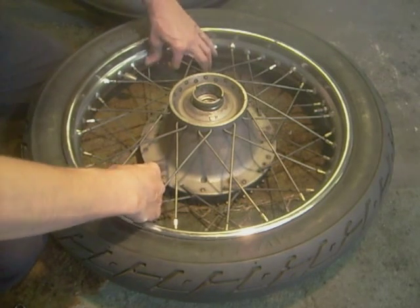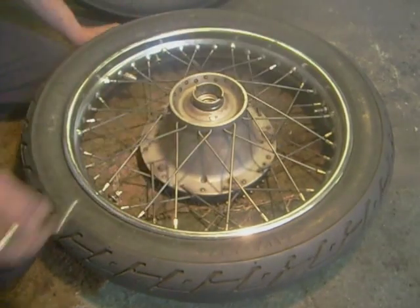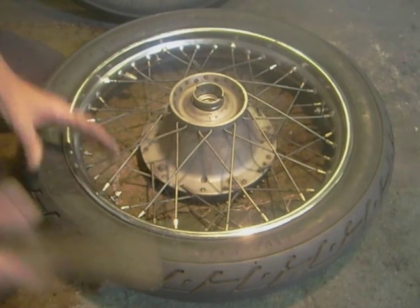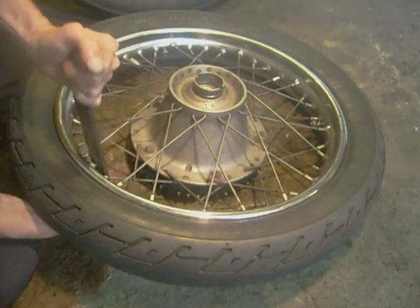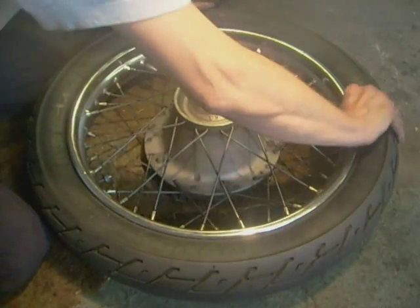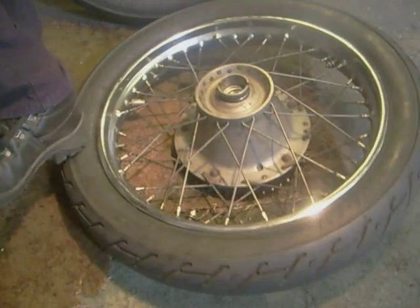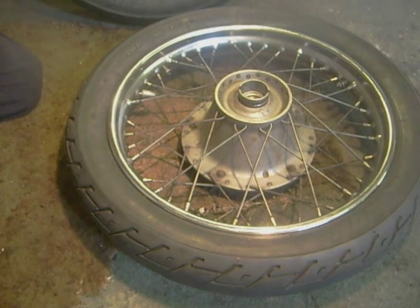Don't take the nuts all the way off — just until they're near the end of the thread. Right, that's done so my tire grips are loose. This is a wide tire lever for a car — just pull it. Get the tire grips inside the tire and the valve so they'll all push up to the rim. Let's see if I can crack it with my feet or knees. Nearly gone — I'll just put a couple of levers in.